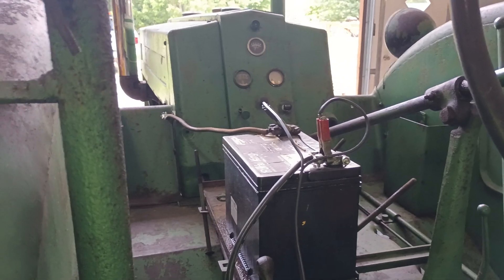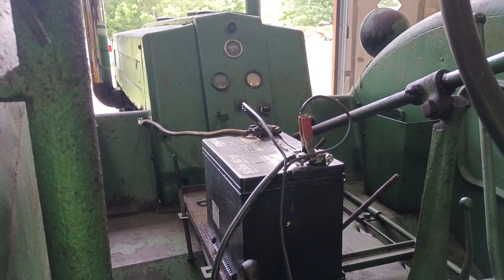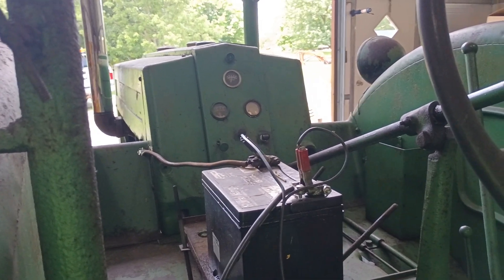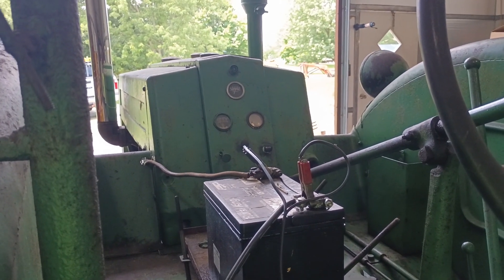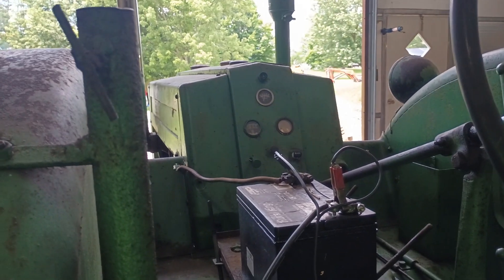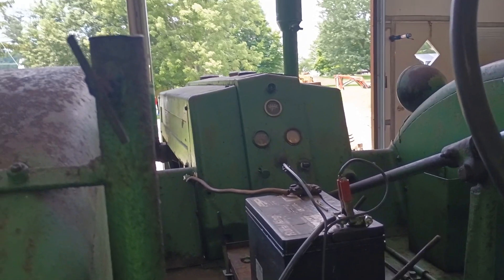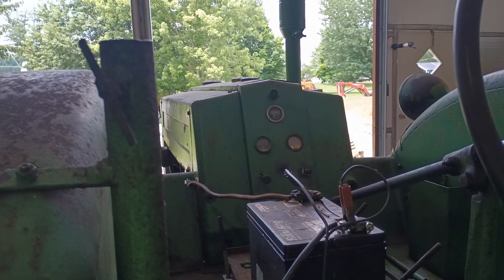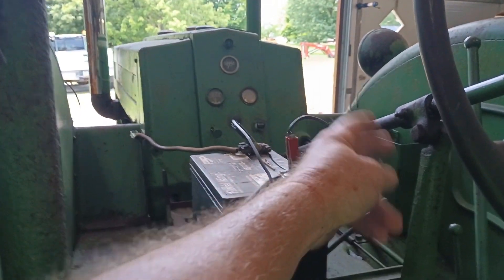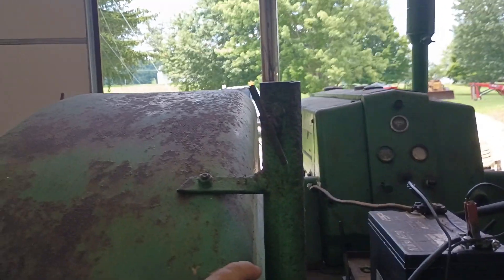Positive terminal to positive terminal, negative terminal to negative terminal. If you have multiple batteries in parallel — where you have two 12-volt batteries but you're still doing 12 volts — you go positive to positive on one battery and negative to negative. I always do it on the same battery. I don't care if it's two 6-volt batteries, two 12-volt batteries, or two 8-volt batteries — you're always keeping positive lead to positive lead on the other battery and negative terminal to negative terminal on the other post on the other battery.